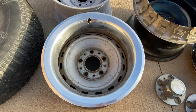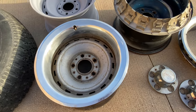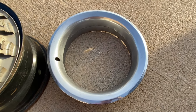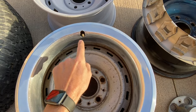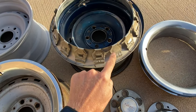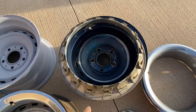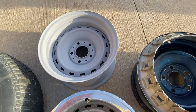Let's talk about the beauty rings. If you have a 15-inch truck rally, make sure you're buying a 15-inch beauty ring. GM produced lots of different beauty rings for different sizes and different vehicles over the years. One way I can tell that this is a truck rally beauty ring is it has a cutout for the valve stem. And if you flip it over, it's got all these pinch or compression points going all the way around the ring, and that's to wedge it onto the actual wheel itself.